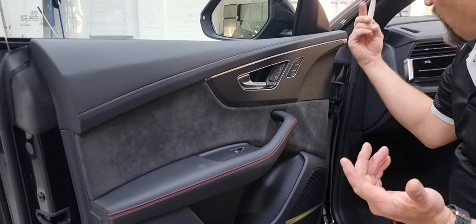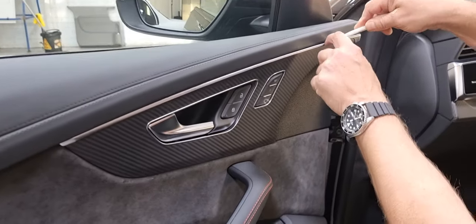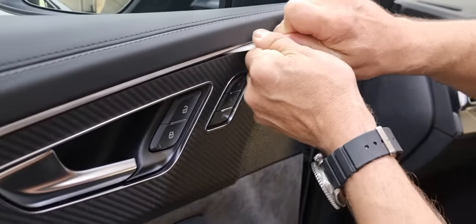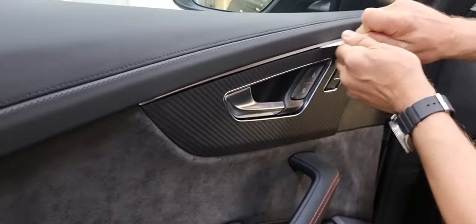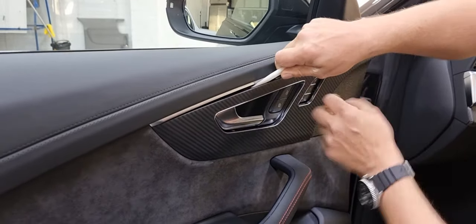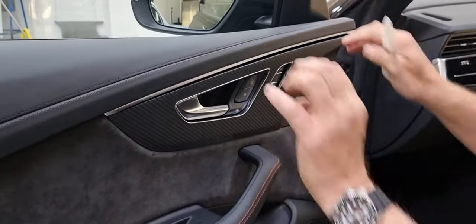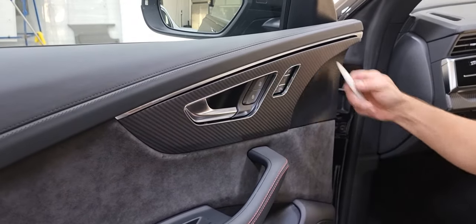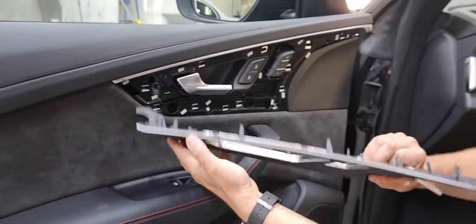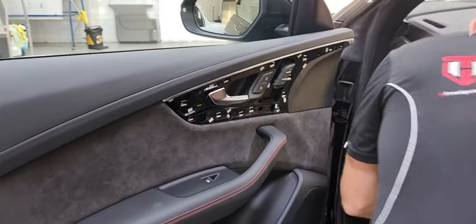Sometimes they're either carbon fiber or they're plastic — it doesn't really matter, they're all the same. But don't lever it in from behind. This silver part here is separate. So just get a plastic tool in here and just sort of run it in and try to separate it. You can come back and just wiggle a tool in there. Don't try and pull that down because it'll put tension on this corner, so if you pop that all the way out it's very difficult to get this part out. Just slide the same tool in here, release that, and then the whole thing comes off quite easy. There's a big hook on the back, which is the reason why you start from the other end. So we'll put that to the side.